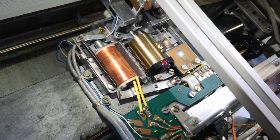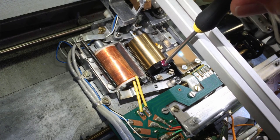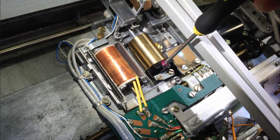The final step is to adjust the tonearm lowering time. The tonearm ideally should lower itself just a little bit before the output relay clicks. The entire process should take about one second. First, adjust the potentiometer for the output relay so it clicks in about a second or a little bit longer. Then adjust the damper — this screw controls the airflow into the damper as the tonearm lowers. Turning the screw in reduces airflow; turning it out increases airflow and makes the damper move faster. It's done by trial and error: use the tonearm lift button to lower it, listen to the relay, and adjust.